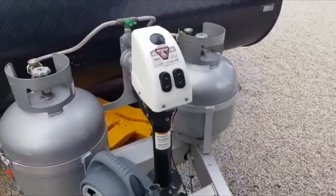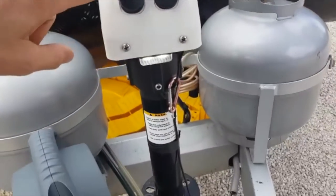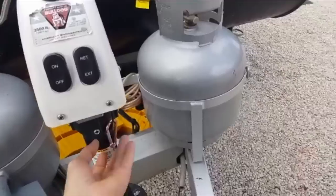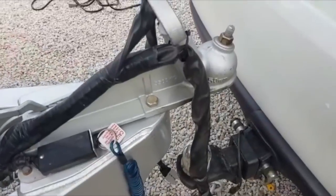I got more questions about this than anything else on our entire trip — this Tough Dog electric jockey jack. It has a light on the front for night time and simple up and down operation. What I'd typically do when getting ready is put a clip under there to hold it, lifting it off the van while I undo all the shackles.